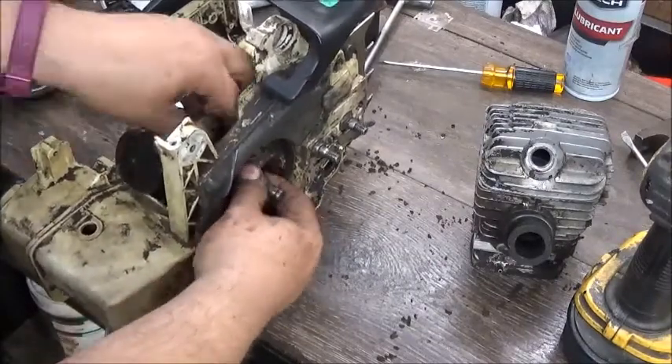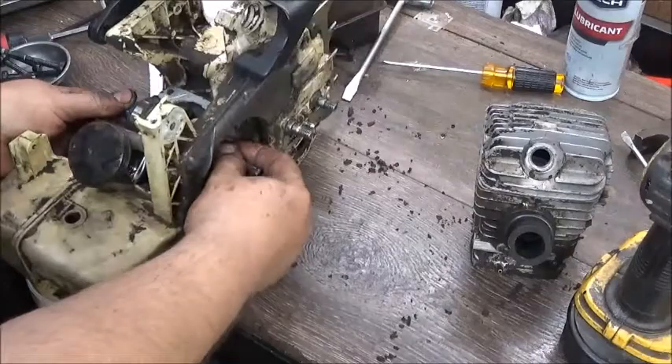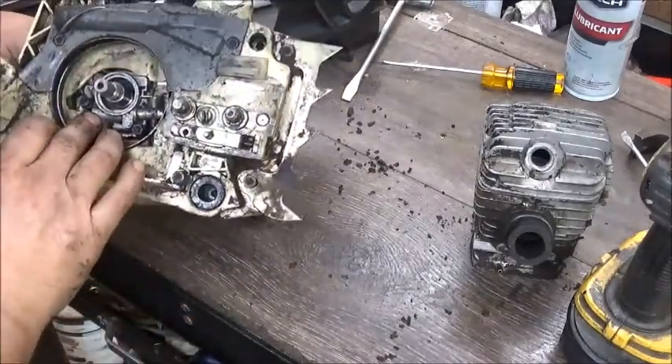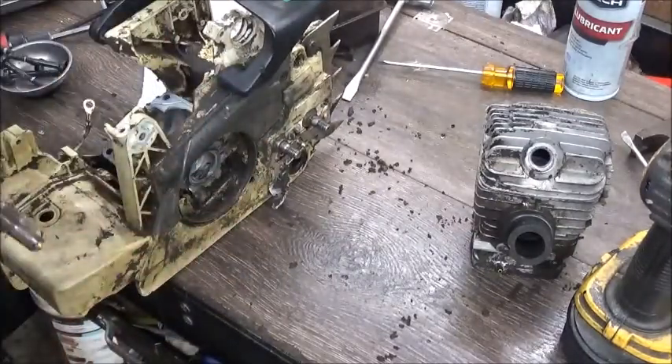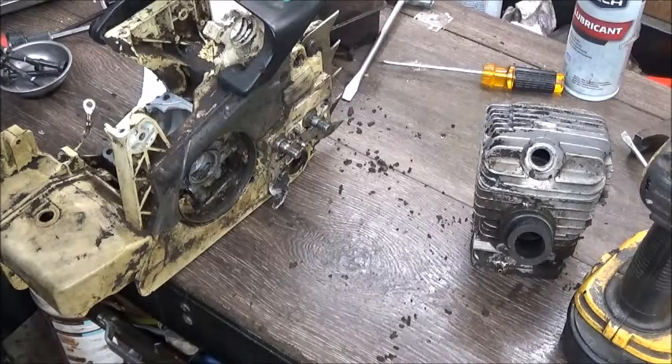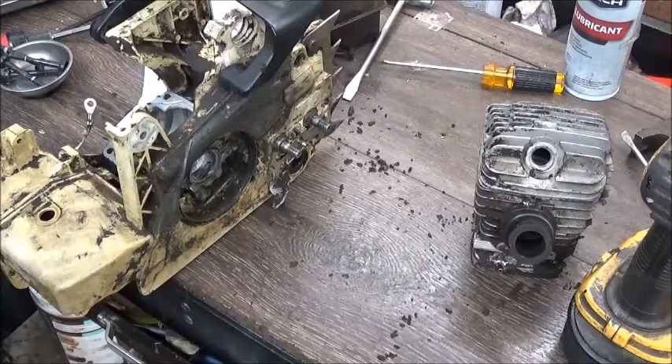I don't remember that oil pump exactly having to come out - it does look like it may be in the way a little, but nope. The PTO bearing was starting to get a little play in it. If we would have got it down and heated it up, I'm sure we would have found that. But the other side - the flywheel side - feels like new. And we have new bearings and seals here to go in the saw.